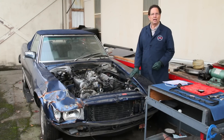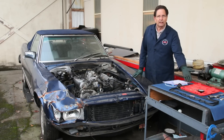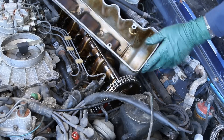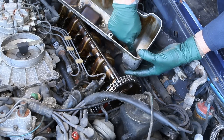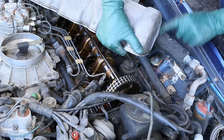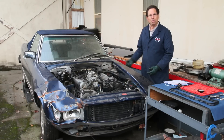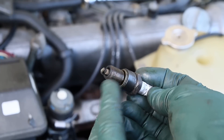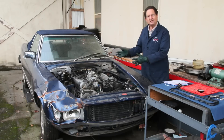So I decided to do an internal physical exam with the engine still in the car. I got it to turn over with the starter, used this kit, and went through the procedure of pulling off the valve covers — and I was very impressed with what I saw. The timing chain is super tight, almost like somebody replaced it. The car has about 130,000 miles on it and no evidence of sludge, which means it's gotten regular oil changes. Then I pulled the plugs and inspected them. I wasn't too impressed with the brand, but the plugs were burning real clean — no heavy oil deposits, which probably means this is not an oil burner.